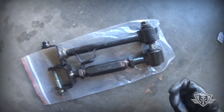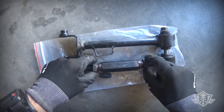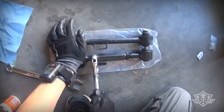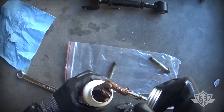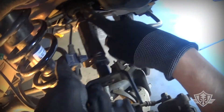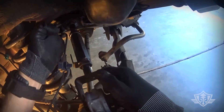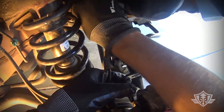We're all nice and lined up here on both sides — it's looking good. We're going to keep this over on this side and go ahead and tighten these guys down. I'm going to use an adjustable crescent wrench to get this guy kind of tight — we're not going to go too tight until after we get it on there. We'll put a little anti-seize on the threads of these. We've placed our new control arm in place, with the little bracket attachment right there facing the front of the vehicle. We're going to do the back first since that one's kind of a pain — we're going to want it under tension while we're doing that.